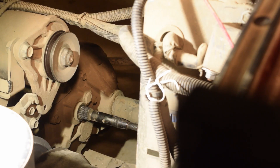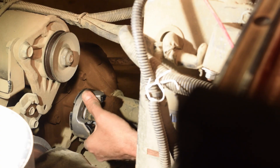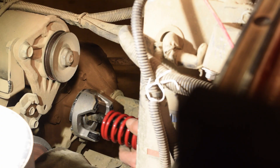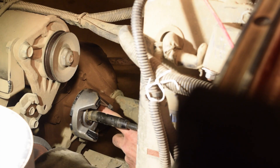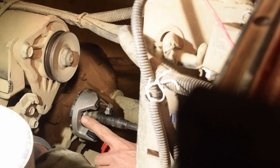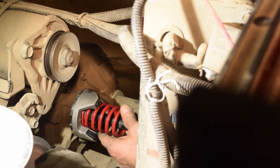But this is already shimmed out. Put this on here like that. Next thing up for grabs is the spring. The stock spring actually fits in these grooves - this part right here has a little tab on it, it bends out, it fits in the grooves. These don't have that. See the heavy-duty spring? It fits like there.